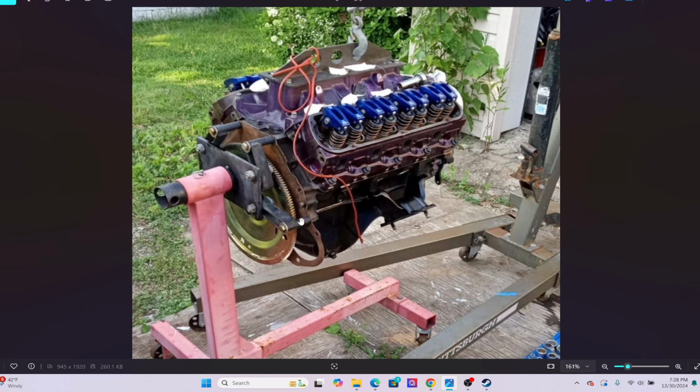And what I had to actually do is, because at this point the engine's already in and the holes are aligned, there's not quite enough play to get the studs to come out of the flex plate. That would be a bad thing if it had that much room. But when I cranked the engine over just a little bit, the torque converter did seat a little more.